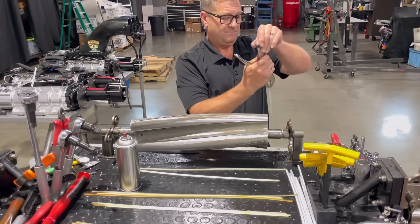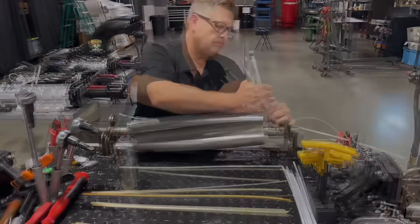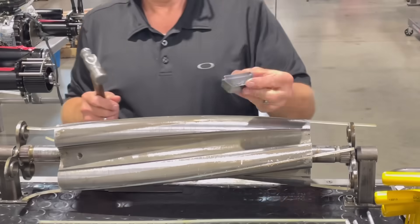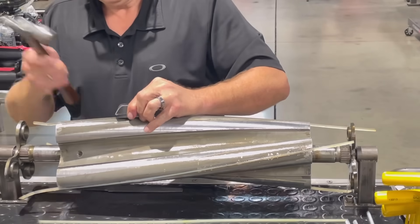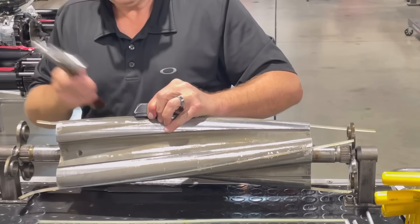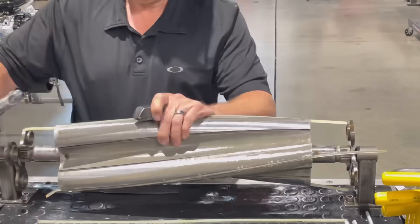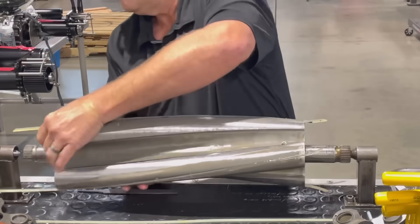When you pull these things in, it's a pretty good effort. I've had the piece break before. I'm just kind of readjusting that screw on the back that holds this rotor — I've actually whacked my elbow on that thing and it's one of the worst feelings. So now that I've pulled it in, it actually stretches this urethane. What I'm going to do is push this urethane back to its normal shape. When you pull it like that it gets real thin, and after a run it can actually shrink, then you'll have a gap at the end of the rotor. So I'll knock this all back in and try to build it back up so when I do cut it, it'll relax to where it's in its normal state.